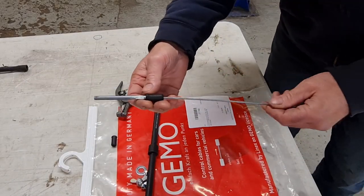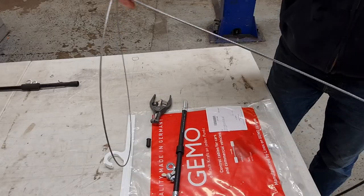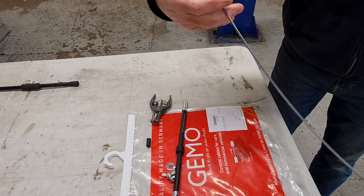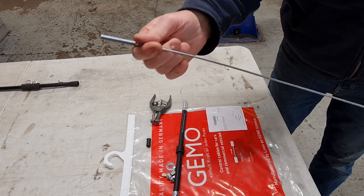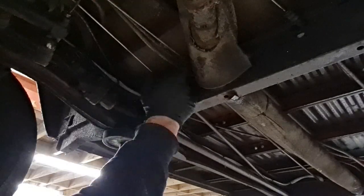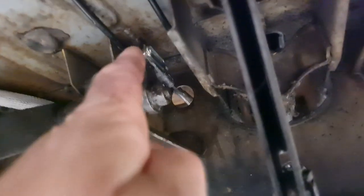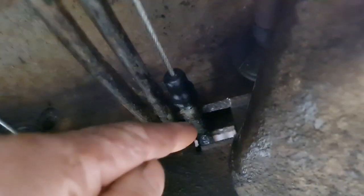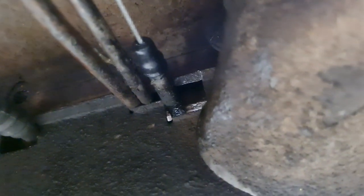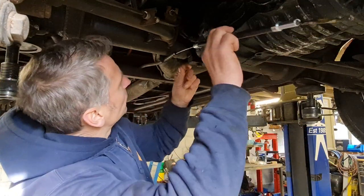Now with our grommet in position, I'm going to move that all the way down the cable for now, up to our plastic part of the conduit. Next we need to get some grease onto this cable and then start threading it into our bus. You can see that's the new cable fitted this end, and then our new cable with our new rubber grommet goes through the conduit — and let's go to the back of the vehicle, where it's all nice and greasy now from going through the greasy conduit tube.